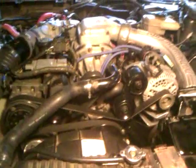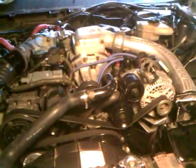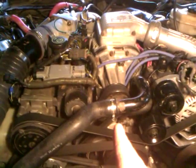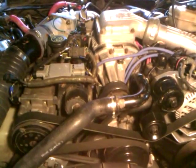First of all, the engine wouldn't keep running because the ignition switch was bad. The crank trigger was getting beat up because when the person painted the motor, he painted the trigger ring and left runs in it, so the trigger ring was smacking the sensor, and the sensor wasn't liking it, so I replaced it to be on the safe side. The old fuel also had some water in it, so I went ahead and flushed all the water out.